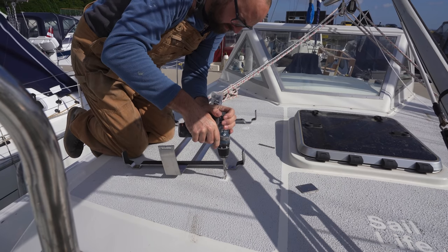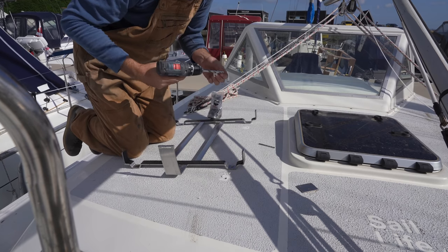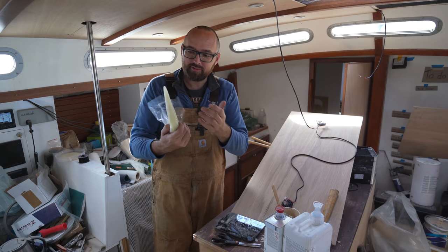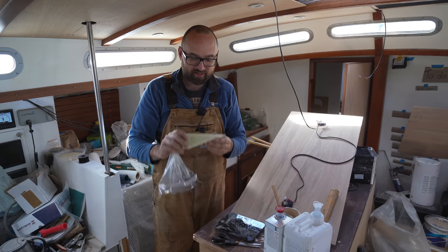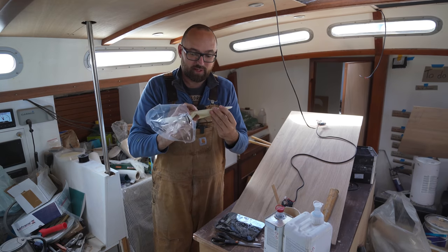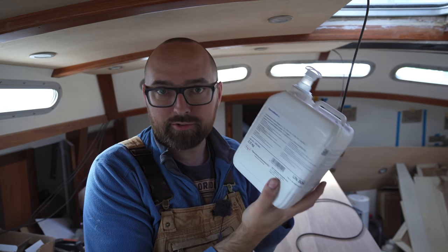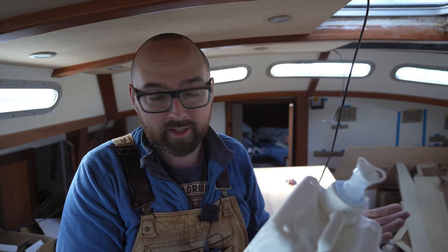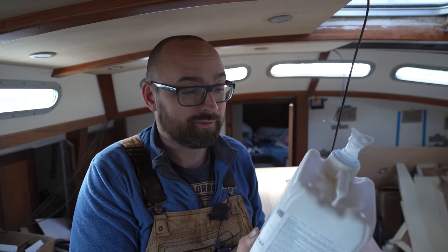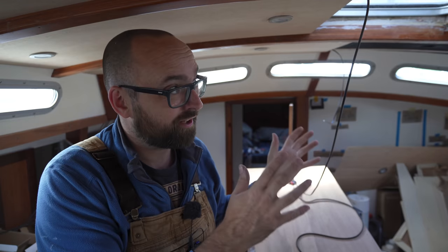Early next morning I went to drill the holes through the thickened epoxy but it must have been cold during the night because the drill came out looking kind of yucky. I accidentally mixed up way too much thickened epoxy yesterday — the stuff left inside of the boat has fully cured, so I know it's not a mix ratio issue, it's just a temperature issue. I believe the epoxy I'm using cures down to 10 degrees Celsius and we might have been skirting that overnight. It just means I need to wait a little bit longer for the epoxy to cure, which is a shame because I was hoping to end this video by installing the life raft — but that's going to have to wait until next week.